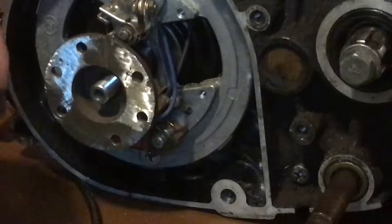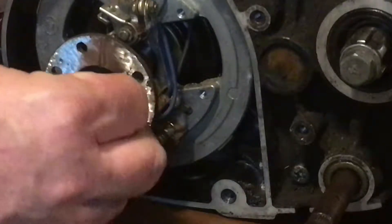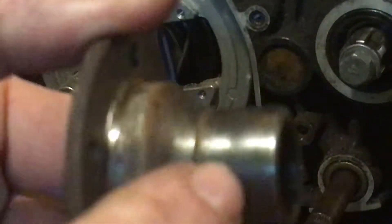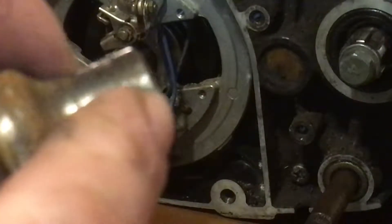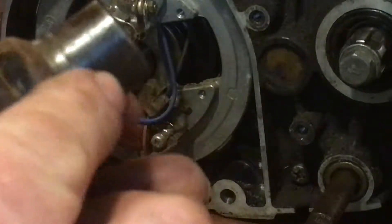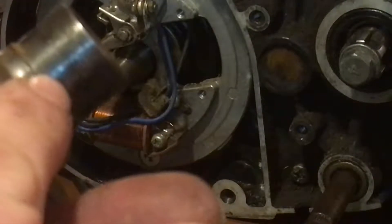What I would do is put the nut on there and snug it up, just as if it were a flywheel. This cam on here is what opens and closes your points, and the felt rides on it. Now I want you guys to look for this on your bikes — there's a lot of pitting. It's like braille, it's not smooth. You can see the shiny areas where it's smooth, and the parts where it's not so shiny — even though I already cleaned this up. See where it's nice and shiny? That's good. See where it's dull? That's bad.